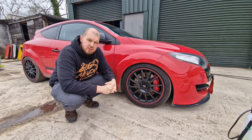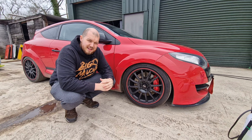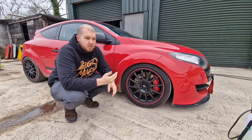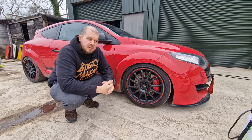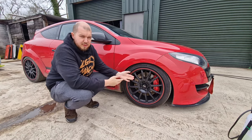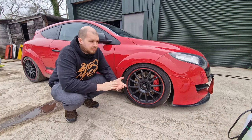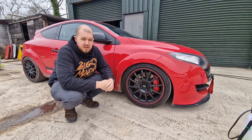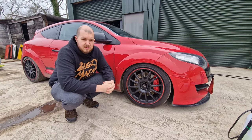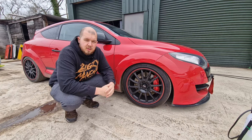We're going to get in there with some brushes and give it a rinse off. With certain wheel finishes you want to be somewhat delicate — this is a gloss black wheel so ideally you'd rinse it off first to get the heavy dirt off. There is a question about whether you rinse off first or just spray your chemical on and go straight in with your contact wash. Pros and cons to each: if you rinse off, you remove some dirt but your chemicals will be less effective because they're diluted with water.